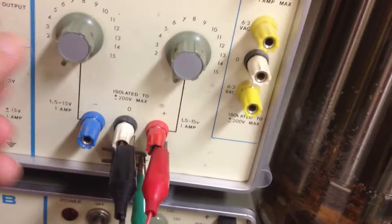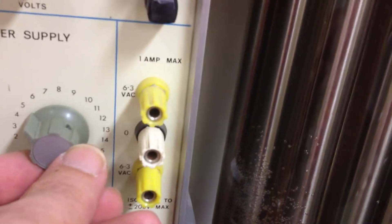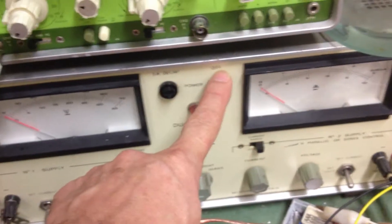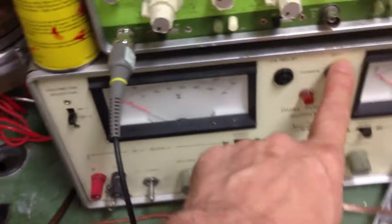It's a bit loud, so I'll turn it on. First I'll turn it up to 5 volts. It'll drag the motor a little bit, bog it down, but not that much. I'll show you the production and my step charge from the alternator — this is what this particular setup has given me. So without further ado, this is the DC supply for the DC motor. I'm still running this — it's only 70 volts, so it doesn't get full speed on the motor, but it doesn't really matter.